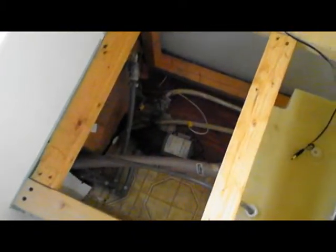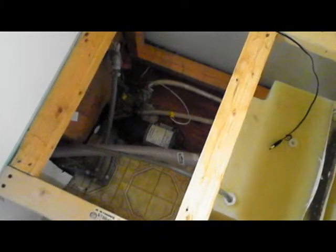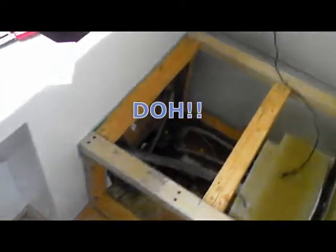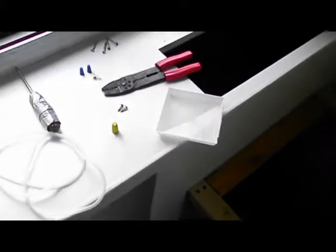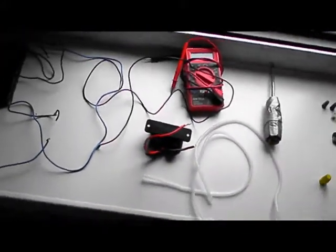Alright, some of you may have seen this coming. The water pump is on a switch, and when you turn it on it pressurizes the water in the system and only runs when it needs to put more pressure through when you're using the water. Because I don't ever use it, the switch is never on, so there's never power to that lead — that's not going to work. There's a light up here that's always got 12 volt power coming to it, so I'm going to tap into that. I went into my electrical junk box and got a nice little wire sheath that I'm going to mount up here and run it down and mount it in the corner. I'll probably leave the old footage so you can see the wires in progress, but we're going to redo it.